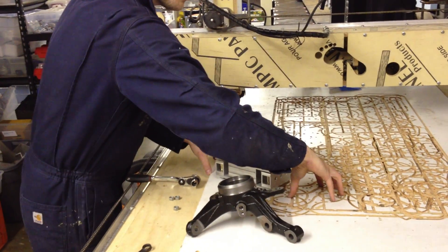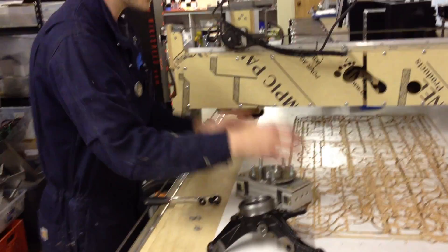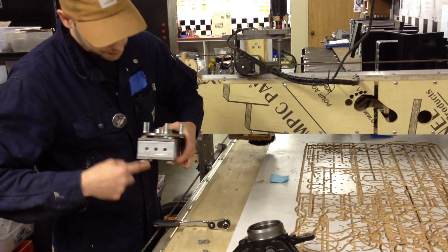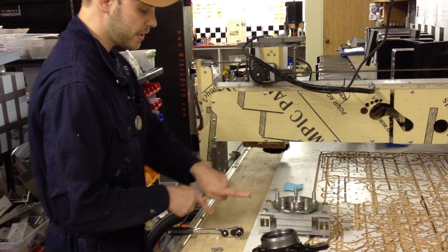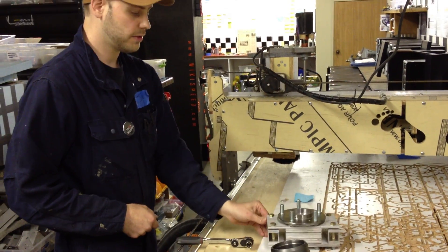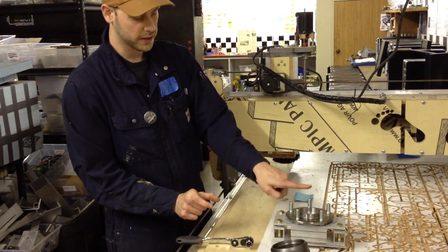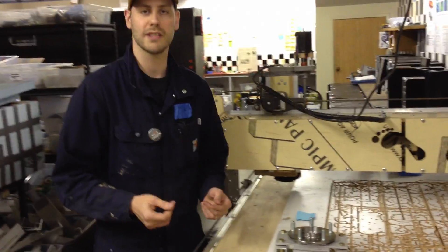But then everything we bolt it to is at an angle, or we've got a bracket with off-angle bolt patterns specific to that angle. So what we're trying instead — and we're attempting it now — is putting our pivot further forward. The part is directly straight up and down, but its pivot point is still ahead of the tire contact patch. So we have static caster without a caster angle; we still have a gap between where the steering point intersects the ground and the friction patch of the tire. We'll see how it works. Modularity lets us run these tests very inexpensively and change very inexpensively — we don't have to recast a new part, which is expensive.